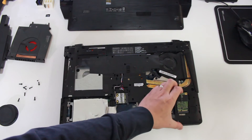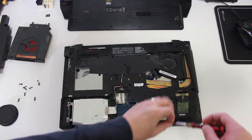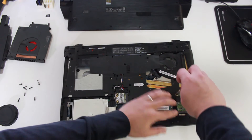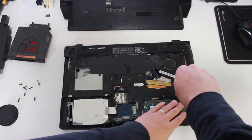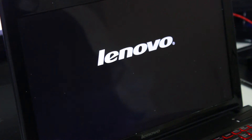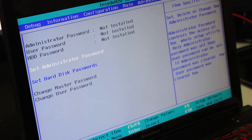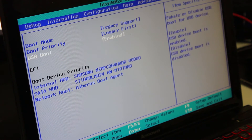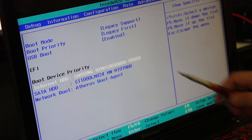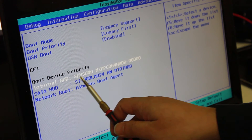When you're done doing this, I wouldn't install everything back together yet. I would flip the laptop over and see if everything boots correctly. To do so, access the BIOS screen as soon as you boot up the laptop and verify that you actually see an internal hard drive. You're going to notice I have two, and the top one will be my Samsung SSD that I just installed.